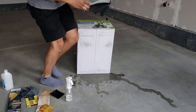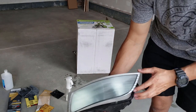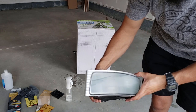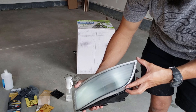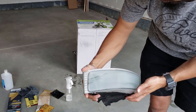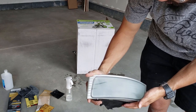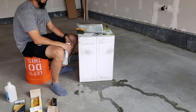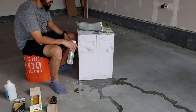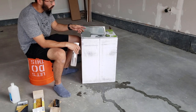This is kind of what it's going to look like when you get done with that second step — just a uniform hazy color, but they're already a lot clearer than they were before and not as yellow. So we're going to move on to that final sanding with 2000 and see how it looks after that. Once you get both done with 800, we're moving on to 2000 grit.